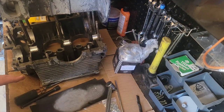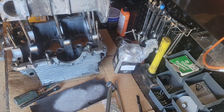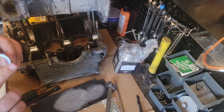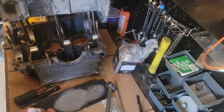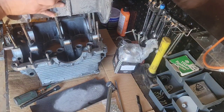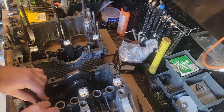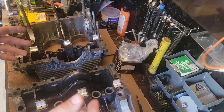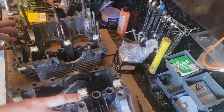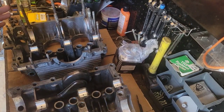Trying to find nice flat working surfaces is kind of hard. A piece of glass works well. If you have other things that you work on, maybe some small engines, if you do cylinder heads and whatnot, you need to flatten the bottom of the head out, you get a piece of glass and use that for your sandpaper surface. Works really well. You just go to your local glass shop and tell them you need about a 1 foot by 1 foot piece, a pretty good thickness of glass. And that's a good true flat working surface. I don't have one. I have my ways, but that's the best thing to do.